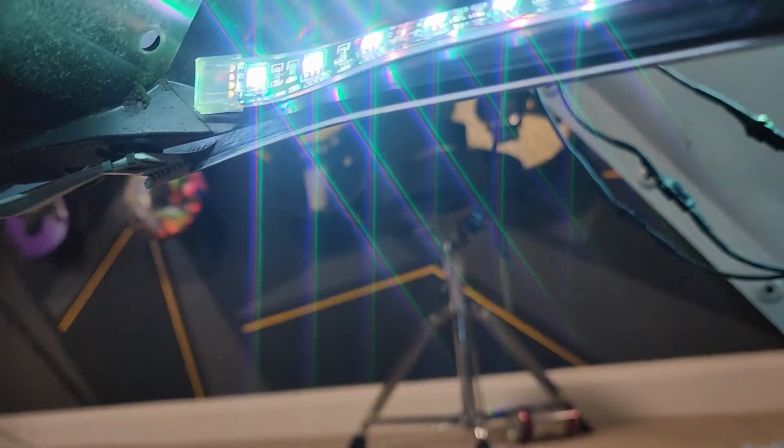It's where the air intake is for the radiator, and it will illuminate down. But I'm trying to keep it away, because the muffler is going to be really super hot off of here. We're going to try to see if we can get these looped up and away as much as possible. I mean, you got a heat shield here and all that, but still, it's going to be pretty extreme heat. So I'm going to try to keep it as far away as I can. Maybe put something over the top of it to keep it from cooking.